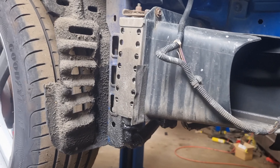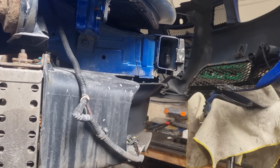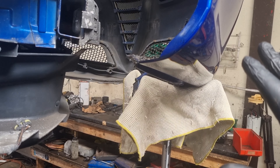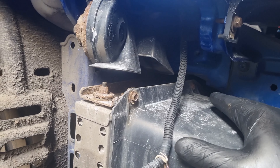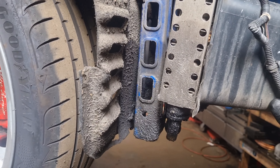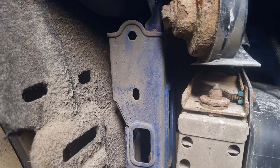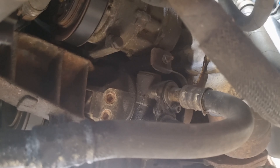So here's the culprit. I have just removed the front bumper and as it's up in the air I haven't removed the other side and I'm supporting it with my crane there so it doesn't cause any stress to it. Quite simple to change - we've got a couple of 10mm nuts on the outside here, a couple of clips here to remove the shield, then a couple of bolts underneath, a couple of bolts at the top and then a couple of bolts up towards the engine there which need to be changed.